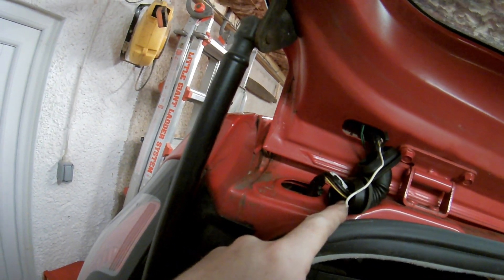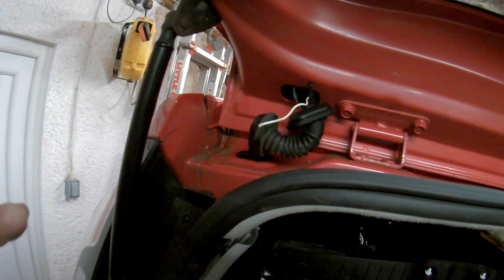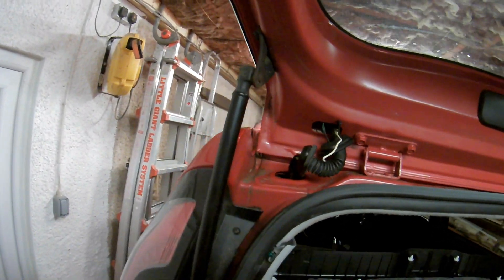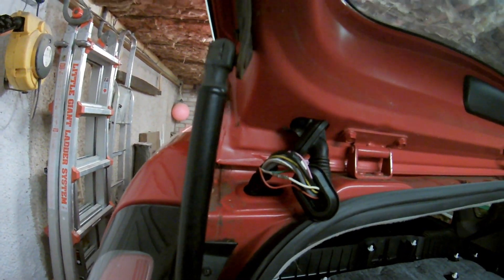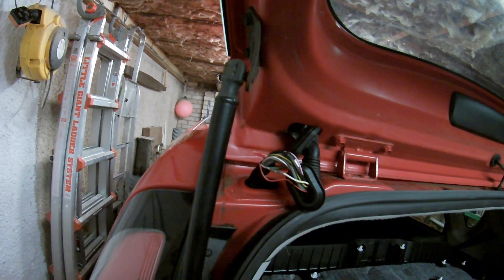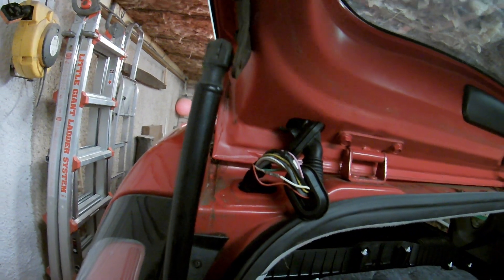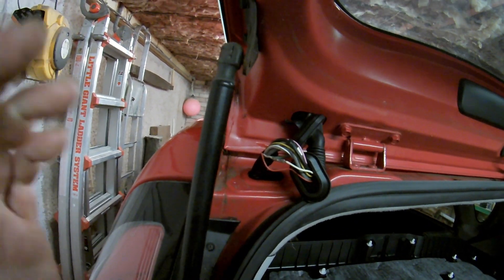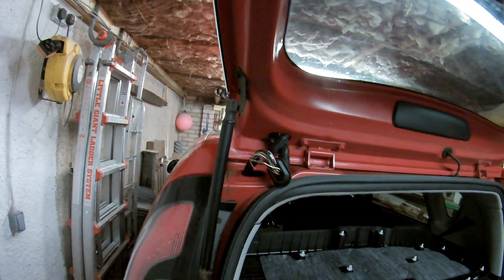So I'm going to have to carefully take some more of the tape off, fish that wire back through, and then join the two together. Now most people would be tempted to use a crimp connector, but this is a flexible point and a crimp connector is rigid, so a crimp connector won't work here — soldering them together is probably the best bet, then put some heat shrink sleeving or electrical tape over the top. I'm going to be honest — I've crimped it. Because it was a snapped wire I couldn't just join the two pieces together as they'd be too short, so I added a little extra wire to bridge the gap. I couldn't hold one wire and solder it to the other, and both sections will have solder on them anyway making them fairly rigid, so I went with a crimp. If it fails again, I know that's the most likely point.